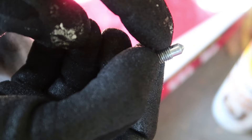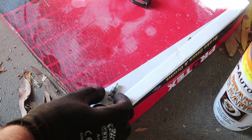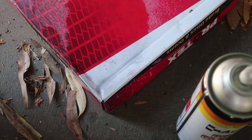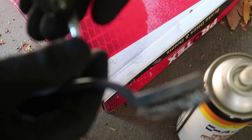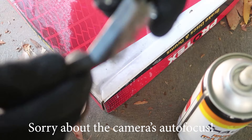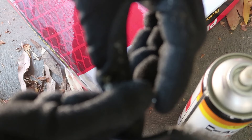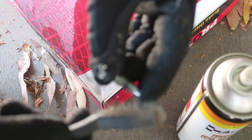See this hole — be careful. We're gonna spray it with the brake cleaner. Just lay it down so the whole face is downwards. Get your brake cleaner, spray it slowly just like that. Then we grab a metal brush and brush it to get all that dirt off — not too hard, gently. And we're done — use the clean cloth to wipe all the dirt off.